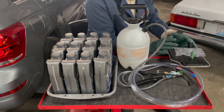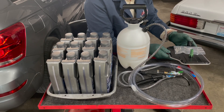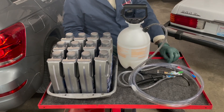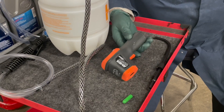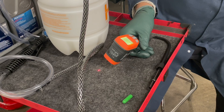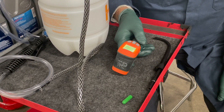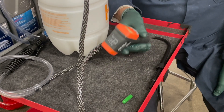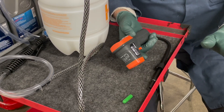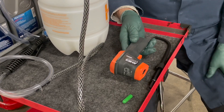Always use the triple media Mercedes genuine filter when changing the filter in the 722.9 Plus transmission. The early ones can be upgraded, but you'll need a new pan. No matter what procedure you plan to do, if you're doing this yourself, you're going to need an infrared thermometer that remotely measures temperature. When we're done with the fill, the procedure to set the correct level in a 722.9 is to run the engine until the temperature reaches 45 degrees centigrade — that's when you set the fill level. Without this thermometer you won't be able to get the correct level.